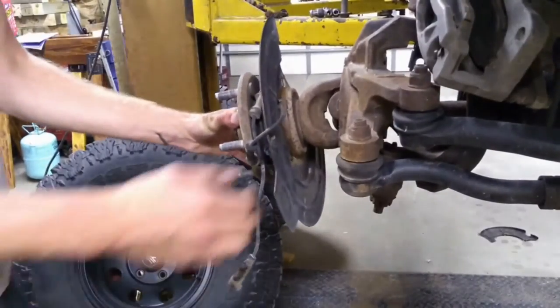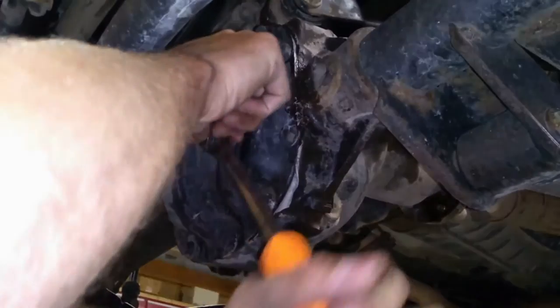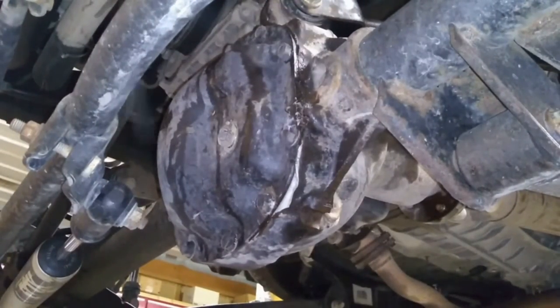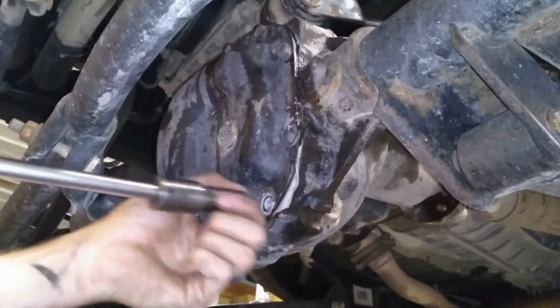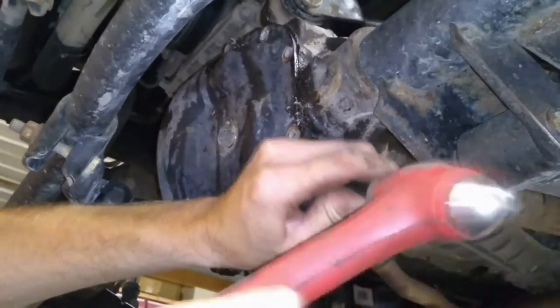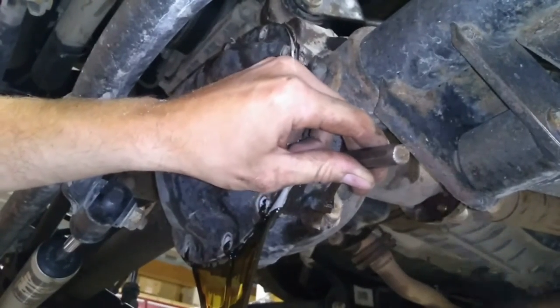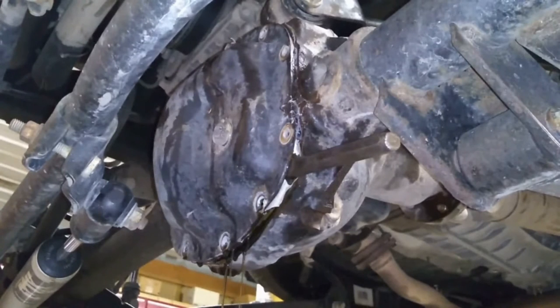The axle shaft didn't want to separate from the wheel bearing, and I didn't want to force it — the axle shaft will just pull right out of there as an assembly. I like to loosen the fill plug before I ever take a diff cover off, so that way I know I won't have an issue when I go to refill it. I took my impact and zipped all the bolts out except for one or two on the top side — loose but not all the way out. Then tap around the cover with a hammer and chisel, being careful not to damage the cover or the axle housing. Leaving those bolts in the top allows me to drain the diff without dropping the whole cover on the floor.